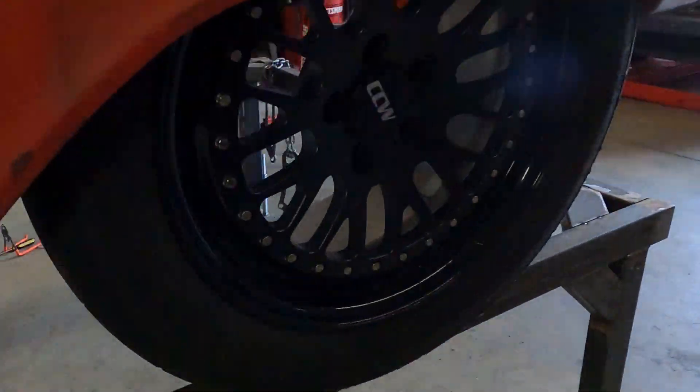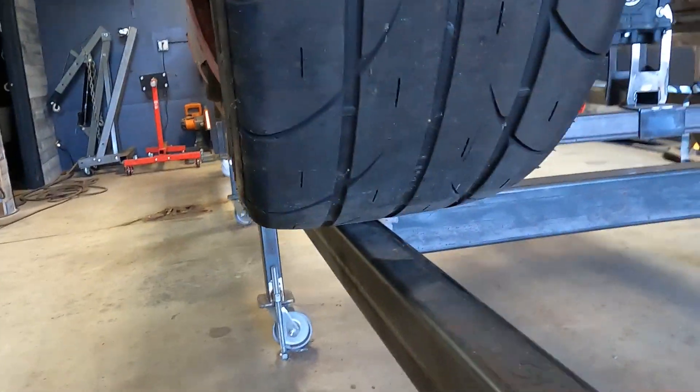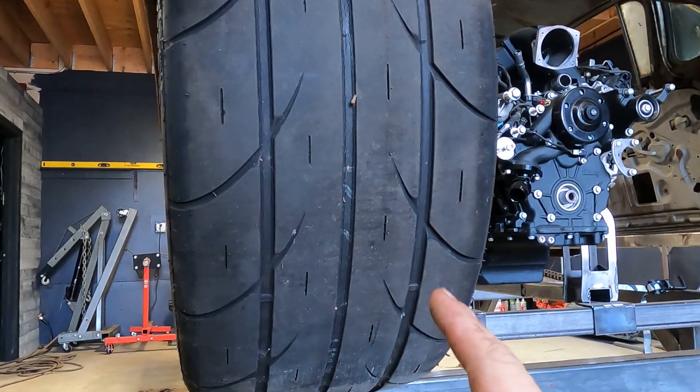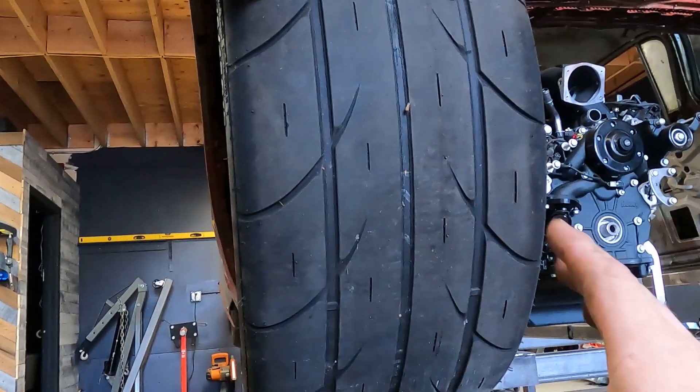My whole plan is to build a chassis around these wheels. I have 7¼ front offset and 4½ in the back. I'm going to have to address the tires. When I originally designed this car a long time ago, it was going to be more of a drag car, so I went with drag radials. The whole idea was this car would be a multi-tool - drag race, autocross, and time attack. So these tires are a no-go; they don't take any lateral loads side to side.